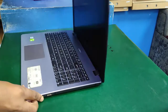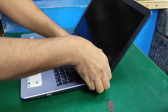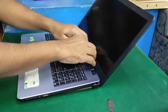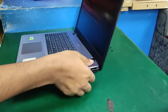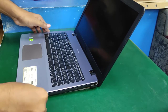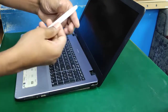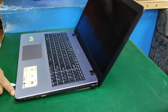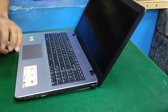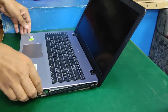All done. Now open the LCD cover using an ejector — I'll use an anti-cutter blade. Open the keyboard module using both hands. If you are not able to, use a plastic plate or another ejector. I already use a plastic plate — just push the keyboard and move your hand. Then the keyboard will be opened.